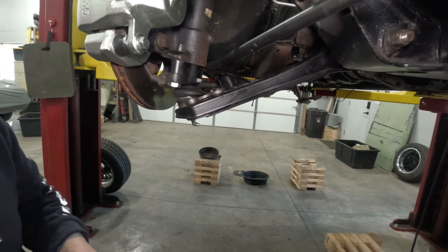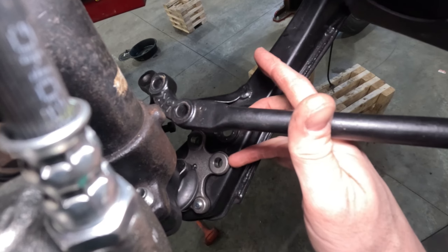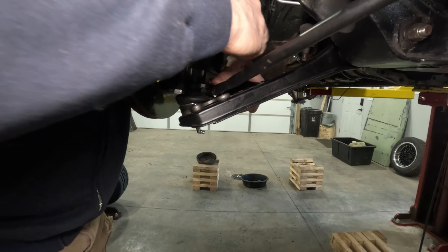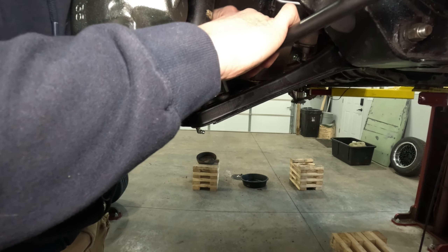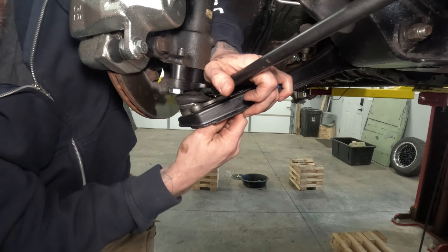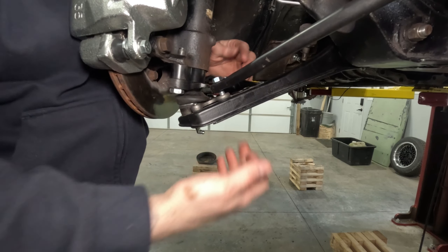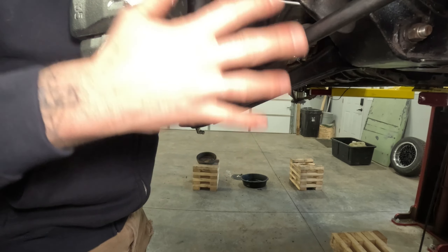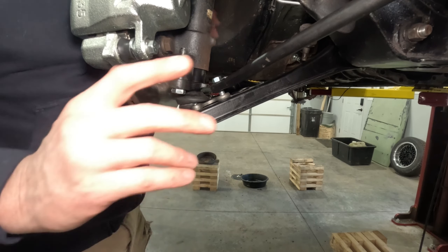The way that this tension rod bolts together: the bolts drop through it and through the ball joint and the lower control arm to bolt this whole mess together. And there you have it - that's how everything is tied together up here. The only thing left is to hook up the steering stuff. I'm going to do all the final snugging in its own video, kind of giving this thing an at-home cheap-ass alignment.